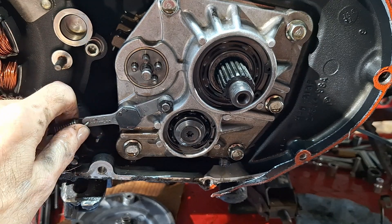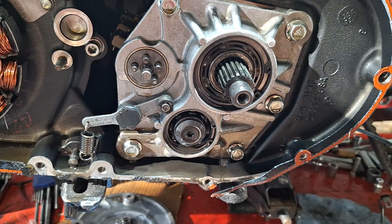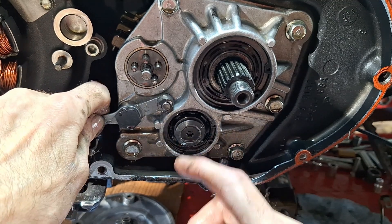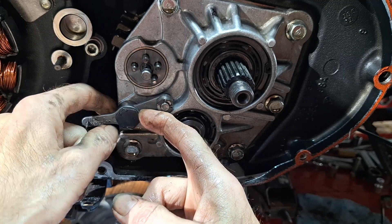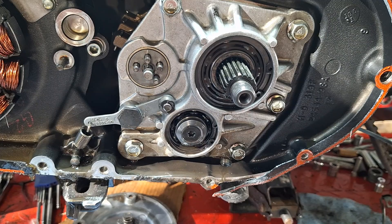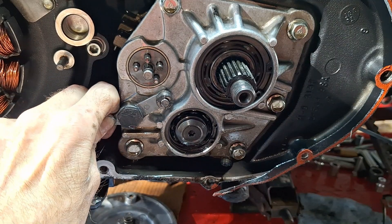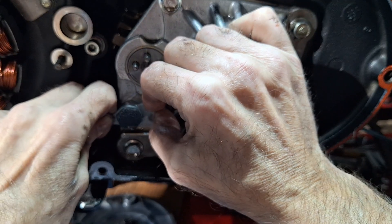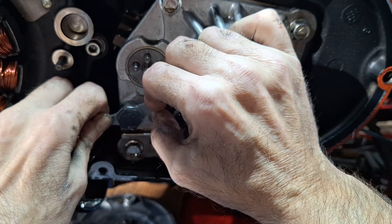Since you're that far in, this is your detent right here — it just kind of holds the shift star. Good idea to feel it and see how much play you've got in there. It's got too much play; it's on a stud — aluminum riding on a steel stud. We'll pull the transmission and I'll pull this off. I don't know what the spec is, but you can feel it — it's got too much play. You don't really want a ton of play in there.